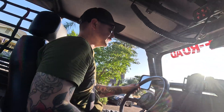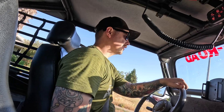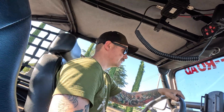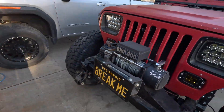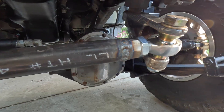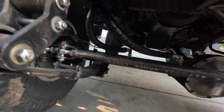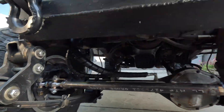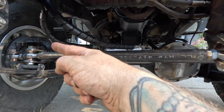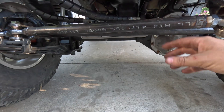All right, we'll take a little trip to the gas station and see how she does. So far it feels really smooth — there's like no slop in the tires or the steering wheel whatsoever. Well, there we go guys. Got my beefy pitman arm, got my double shear add-ons to these Dana 44 Wagoneer knuckles, and then this beefy monstrosity that connects it all. I think the coolest part of this steering setup is that these are so low and parallel — because when this pushes on the tie rod, it's not wanting to spin as much as it would if you had some angle on it. So I think we're kind of minimizing that with how low it is.